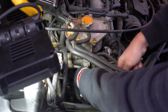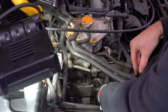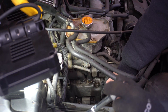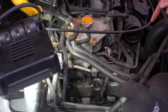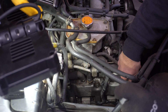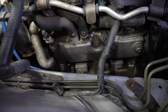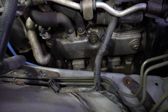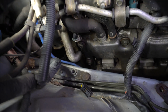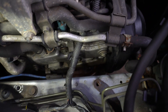So that's one out, two out — just gonna go slowly releasing them. Now we're gonna have three up here, then one and two there, and another three at the bottom. The ones at the bottom people do say are quite hard to get, but if we go under the car — jack it up or maybe take the wheel off — we should be able to get to them. The three top ones are 10mm and the ones holding the coil packs are 12mm. The other ones at the bottom are gonna be 10mm as well. So the one on the right hand side and the one on the left which is gonna be a bit harder to get to because you're quite close to the subframe — you're gonna have to use a spanner.